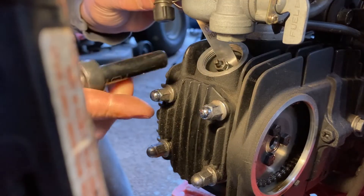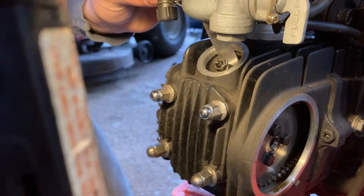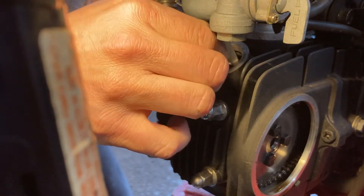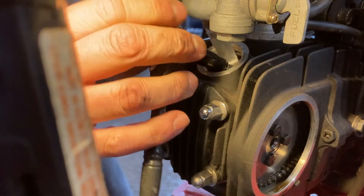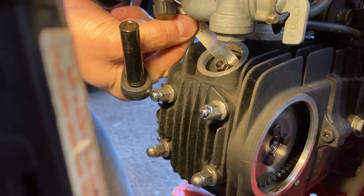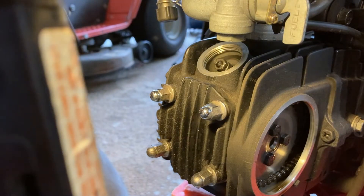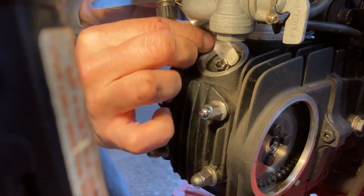What I'm going to do is loosen the valve here — this is a 9mm. I'm going to loosen it and you can see I'm just finger-tightening the bolt from the top to get that feeler gauge tighter than it was. Then I am tightening that nut once again, and I'll be able to put the .08mm in afterwards. It should have some drag but it shouldn't be loose and it shouldn't be too tight either.